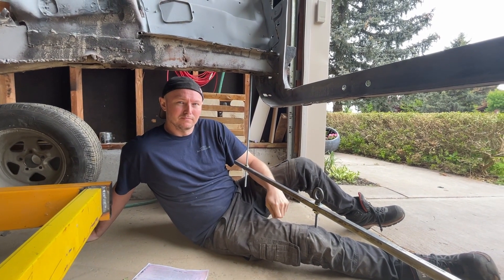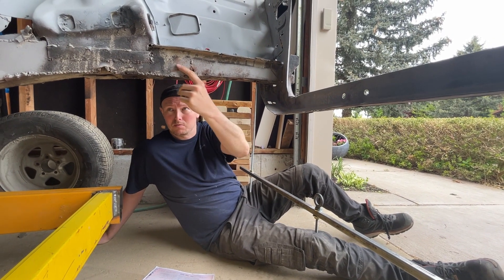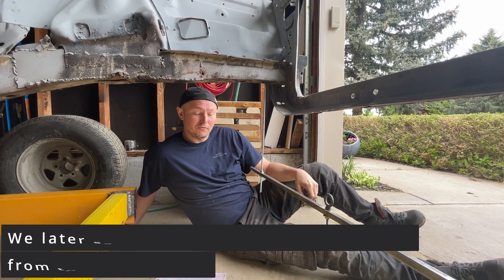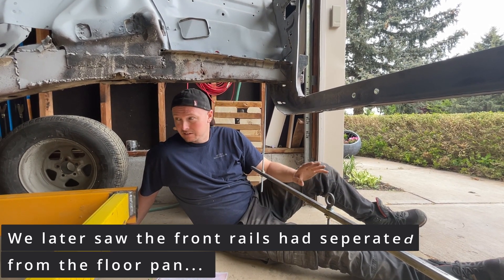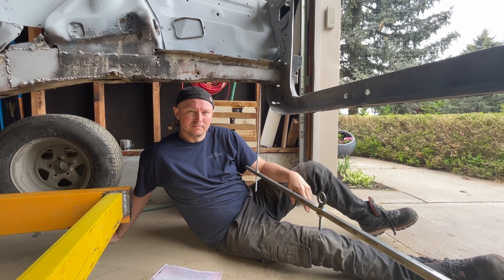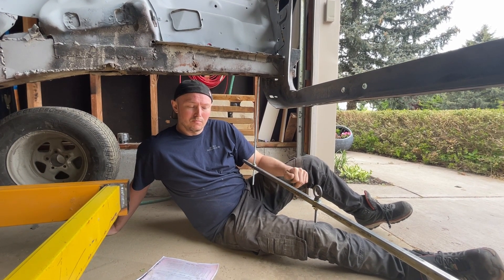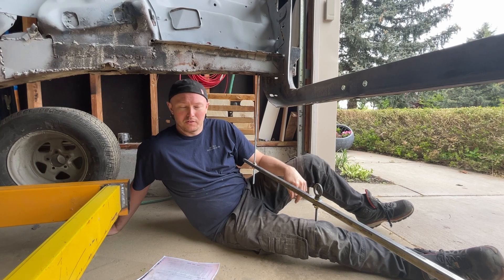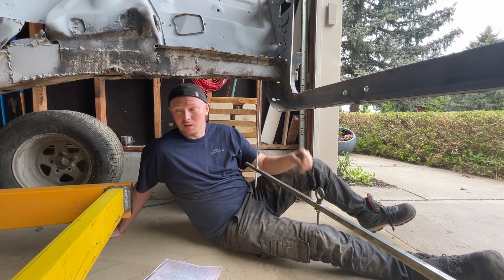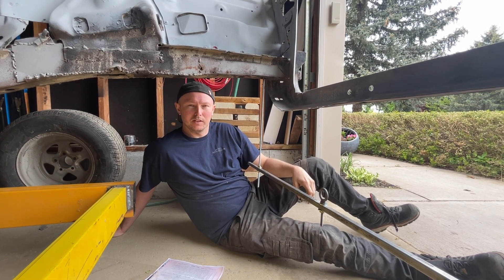So when we measured this car, how did it all turn out? For the most part it looks pretty good. We knew there was some damage up in this front rail — you can see there's a big patch up here — so the front end looked a little low. But there's no twist to it, the rails in the back look good, and the center section of the car looks good, which is a good base to start this project. If everything is relatively square and straight, the replacement of the rails going forward is much easier — we don't really have to worry about the front rails being out relative to the rest of the car, and that'll give us a straight car with nice door gaps.